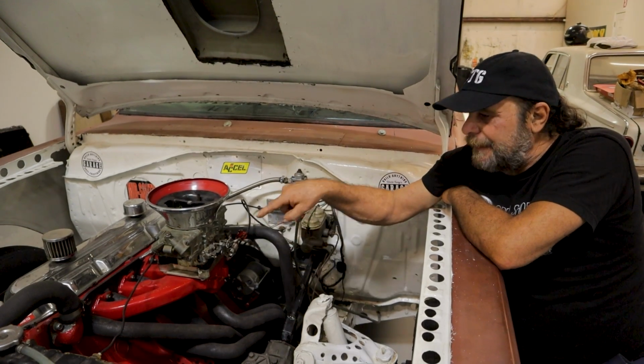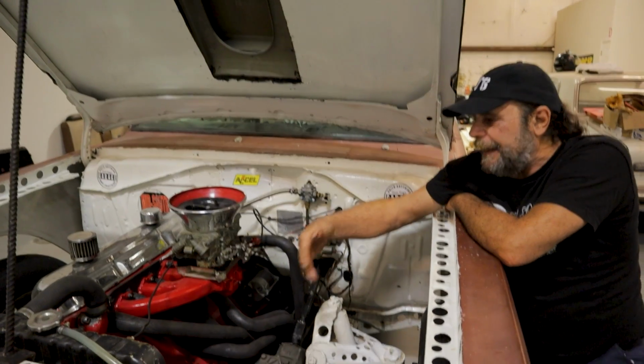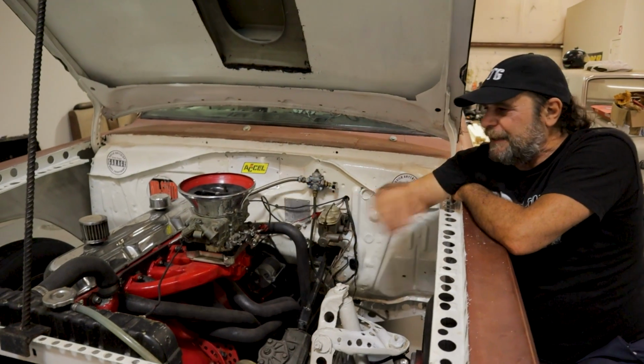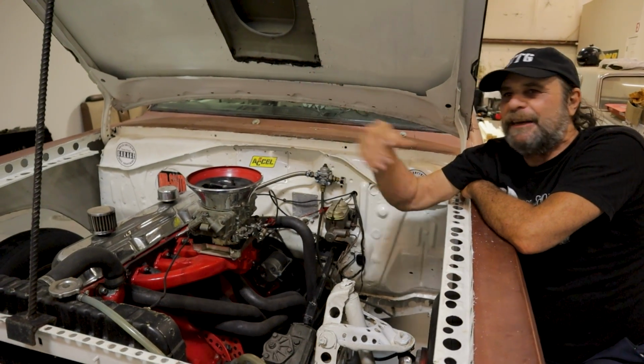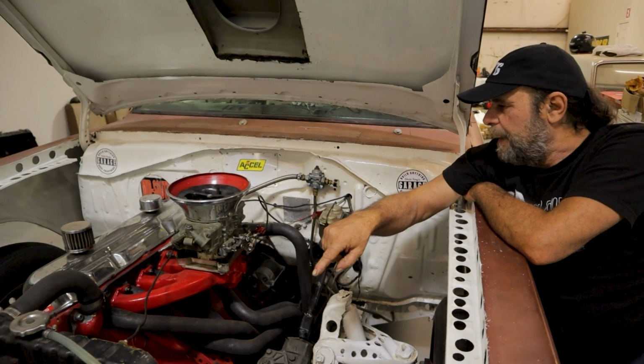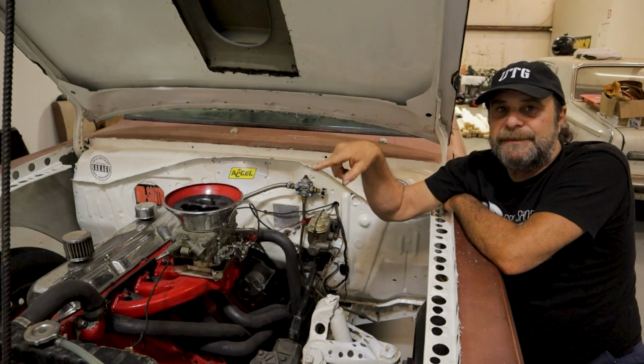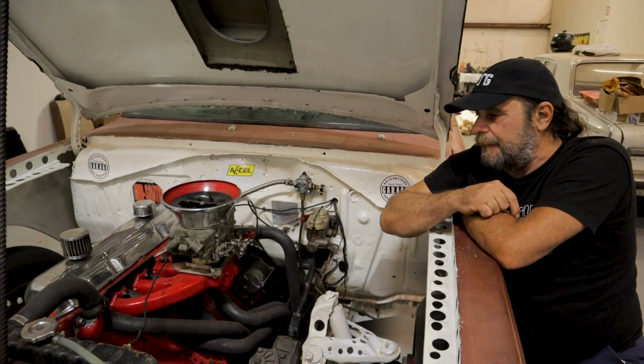It's the basic inherent design of that Slant 6 intake manifold, sitting way off the engine, aluminum, so it's dissipating heat like crazy. That, I believe, is our main problem. So next time out, not this Saturday, but we're going to go out next Saturday with it. Hopefully that'll clear it up.